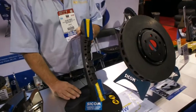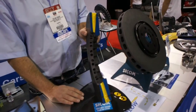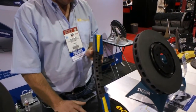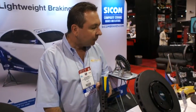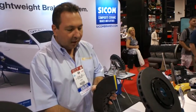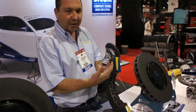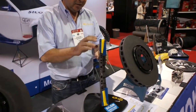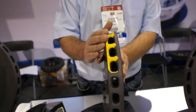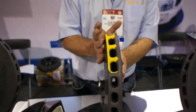As far as air flow goes, these rotors are specially engineered in order to efficiently get rid of hot air. The name of that technology is called Axial Flow. Most of the hot air build-up is created around the hub. The way these are designed is to take that hot air and move it through the vanes. If you look at the profile of the rotor, it's slightly angled out 5 degrees towards the wheel in order to push the air out through the wheel so that you have more efficient cooling of the brake system.